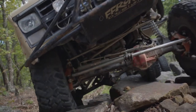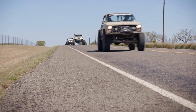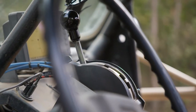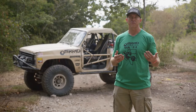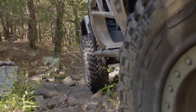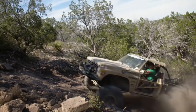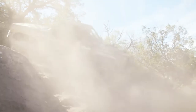You still have two middle gears in addition to your one-to-one high gear for going down the highway. On a typical day at this park, we check in, air down, lock the hubs, and put the 205 in single low. As we drive on hills, we're not lugging the engine or heating up the transmission. When we hit harder obstacles, we can drop into double low for extra control and crawl up everything. And if we need wheel spin or momentum, we have two intermediate gears to create the bump or wheel speed needed to climb a hill.